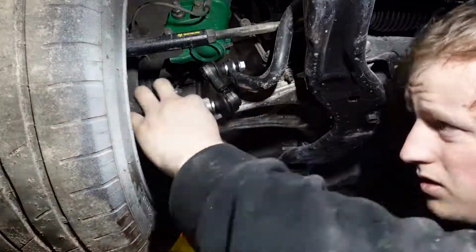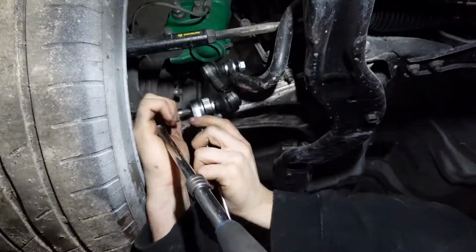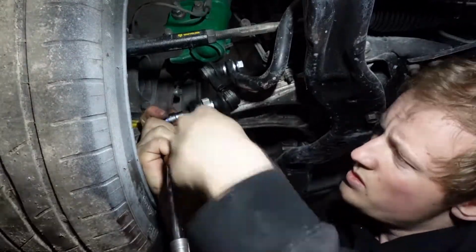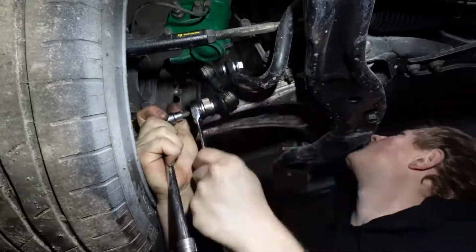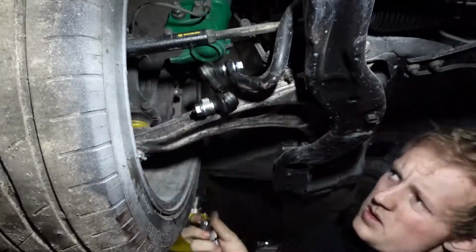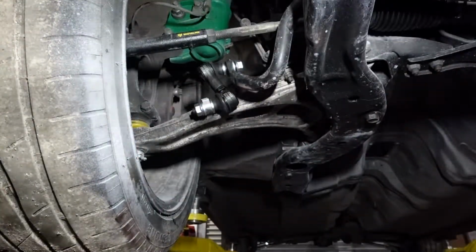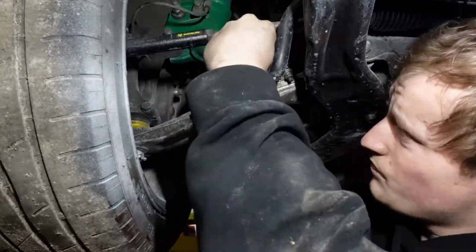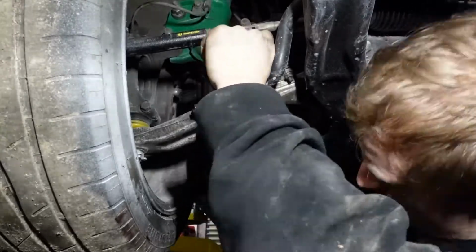So luckily I still had a set of OEM end links from the WRX that was on the old sway bars that I could quickly get measurements off and measure accordingly to ensure that the sway bar end link length was perfect. When putting any adjustable suspension in, you always want to start with the length of the stock before you actually start adjusting it.